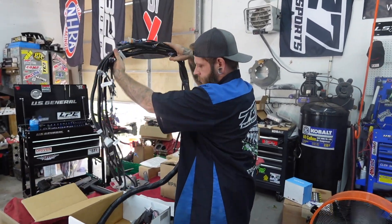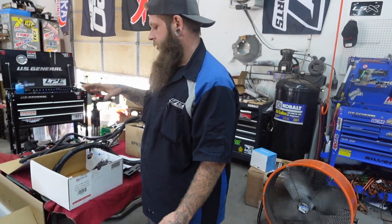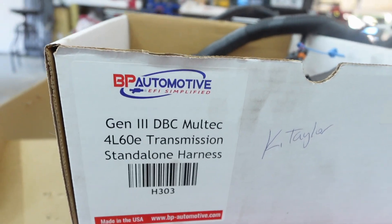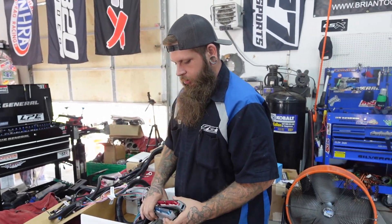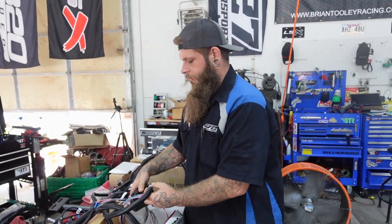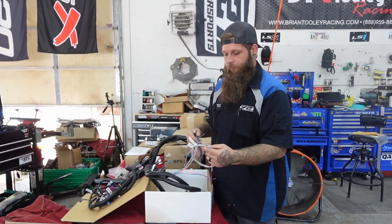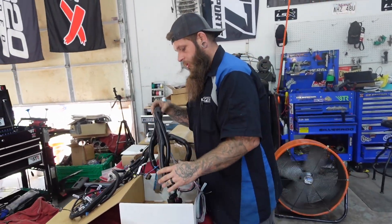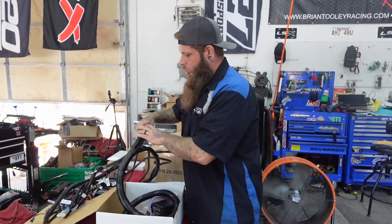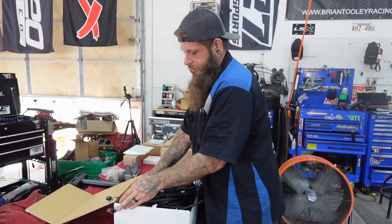If you're looking to simplify EFI, then BP is the way to go. There's everything for the engine right there. You get on there and tell them what alternator you have, what injectors you're running, whether you're gen 3 or gen 4, whether you're drive-by-wire or drive-by-cable, and they essentially build you a harness that's built for what you need. For this particular one, we're going drive-by-cable. We've got transmission control and we're running multi-port injectors. We're going to be running a 99-to-02 style truck PCM with red and blue connectors. We've got our standalone fuse block. We did not opt in for the fan control on this, so we are going to have to get a fan harness, but we've got our fan relay controls, our fuel pump, and our various wires that go inside the dash and a quality OBD2 connector. This is what we'll be using to run this thing — keeping the engine bay tidy, no old busted wiring, no extra wires from a stock harness being improperly de-pinned, no broken connectors or broken wires. And this unit's been tested.